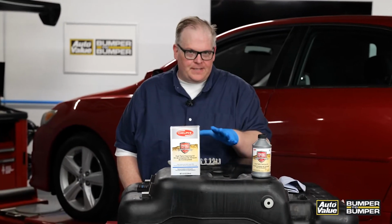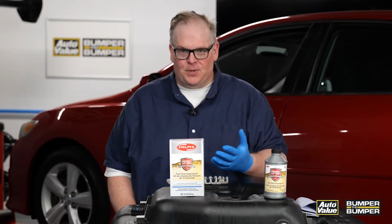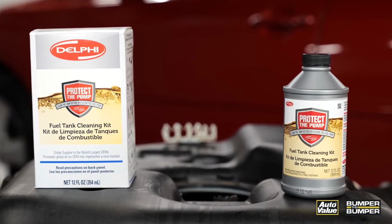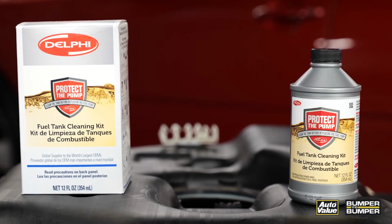So what are you to do to return that vehicle to like new condition so the replacement pump that you're probably warranting can last another 100,000 miles? Well, you need to clean the tank. So what's the right way to clean the tank? Well, there are a lot of homespun remedies to do this, but this is a kit designed to clean a fuel tank. A fuel tank that can be as large as 40 gallons.